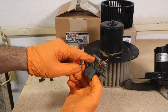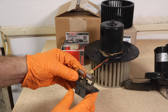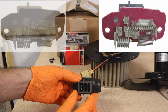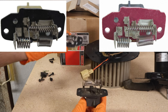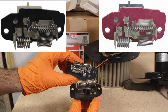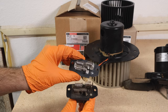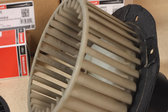The blower motor resistor may have two different temperature cutouts. For this truck, there's a 250-degree or a 300-degree temperature cutout, both manufactured by Ford Motorcraft. The red one is the 250-degree cutoff. I opted for the 300-degree version. Just make sure you get the correct one for your car or truck — for this truck it calls for the 300-degree cutoff.